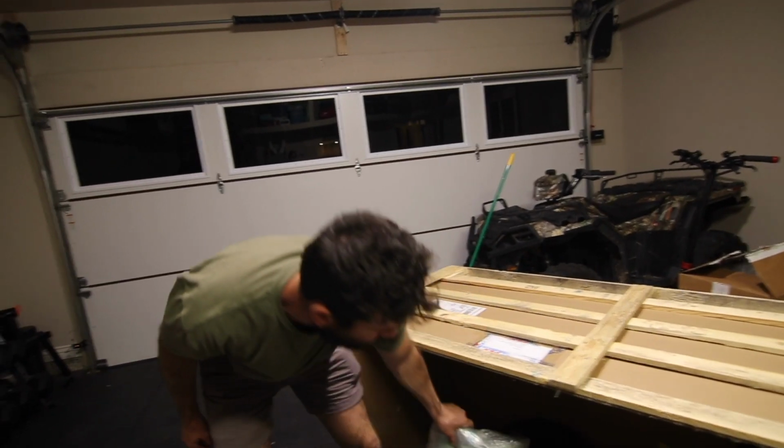Yeah. We do have an enclosed trailer. Keep in mind, the width of this trike is exceptionally wide. It's about 6.5 feet, maybe a little bit more. If you're going to be traveling with your trike and you live in an area where it rains a lot, or you do a lot of fly-ins, then you would probably want to invest in a trailer. We'll be able to fit it in our trailer by taking off the tensioning cables that will allow the rear wheels to come in, and then once we get on site at our location, we can once again open them up and retension the cables, maybe over the course of 10 minutes, I'd say.